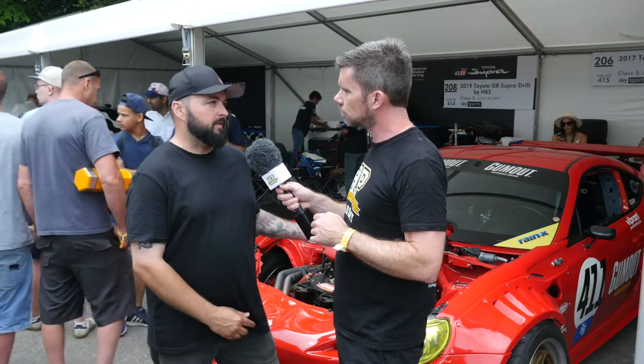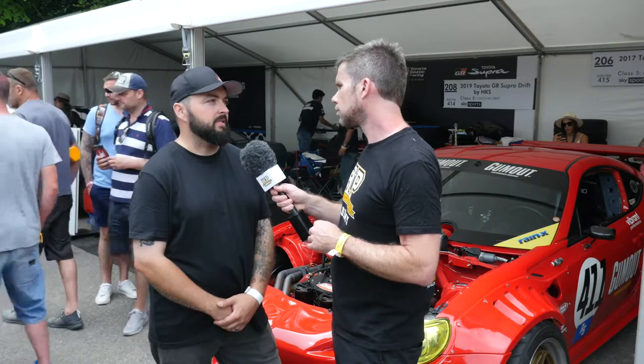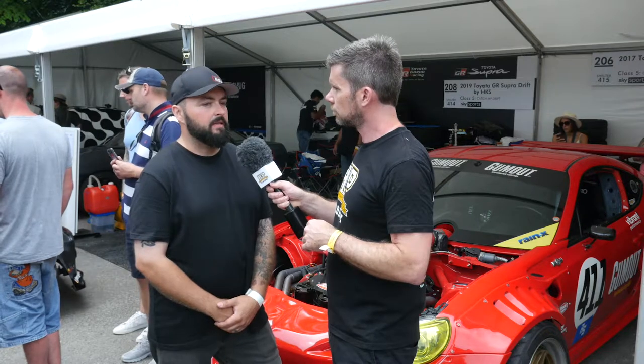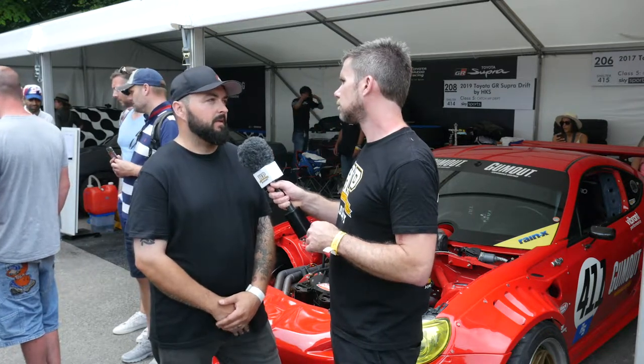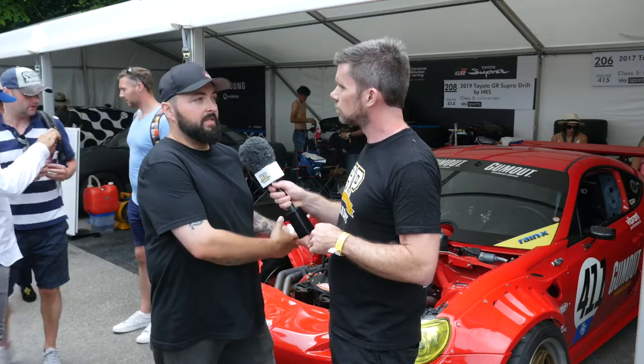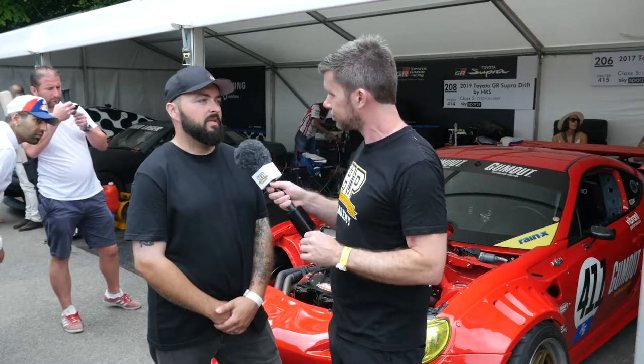It's a John Reed Racing firmware package. I built the looms for this car and I've known John for many years — actually worked out of the same facility as him — and we were able to work together and get everything done. In the process of him making the firmware, he made it so you could swap this into a stock 86 and have the AC, power steering, ABS, and everything work. So basically within his custom firmware he's replicated all of those CAN messages to keep all of those factory electronic components happy and functioning as normal? Yes, that's correct.